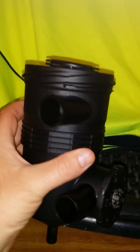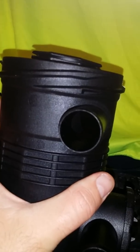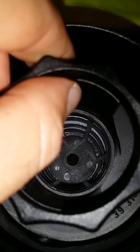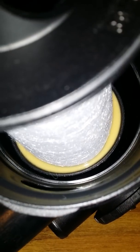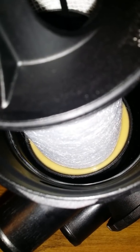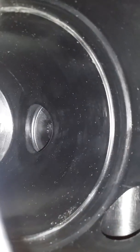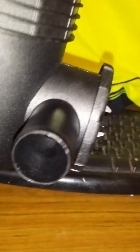This is the catch can — this is the inlet, that's where the gas gets pushed in. It swirls around and goes down through the filter, from the inside to the outside, and the oil drops and falls off the outer walls of the filter. We take the filter out and the oil falls down into that catch area. The gas and air go through that hole, which is the outlet hole.